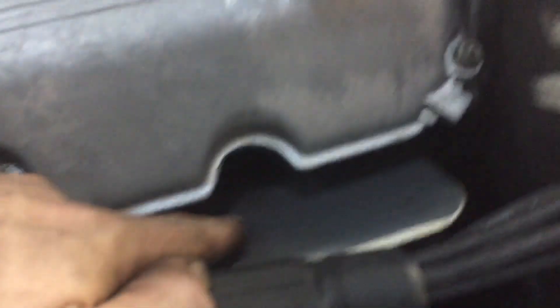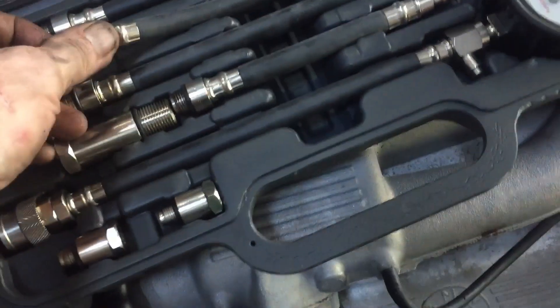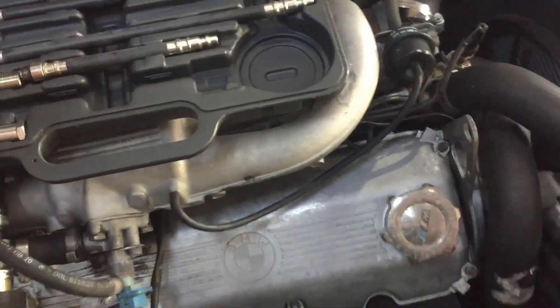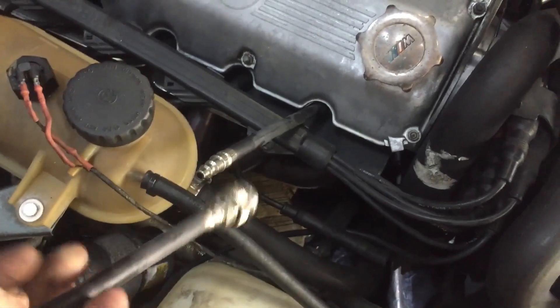The second thing you have to do is, down in this hole there's a spark plug. You have to take this spark plug out and match it up with the threads to one of these adapters. Let's say it's this one — then we screw this down in here. Then we take our gauge here, and you see how it pops on and connects through here. See how the gauge works.